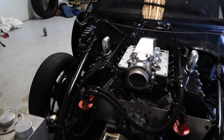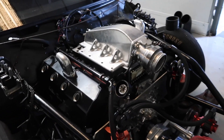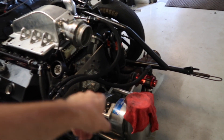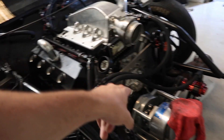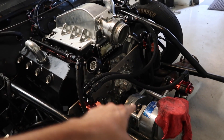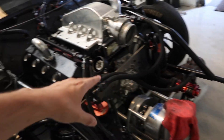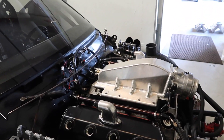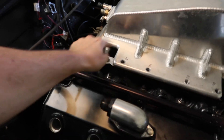Right now we're suffering from a boost leak issue. As I said in the other video, this thing is attached to the motor directly, one-to-one. So as RPM increases, blower speed and boost increases. There's no reason why RPM should increase and boost would flatline unless there's a leak somewhere. I'm pinpointing it to somewhere in here.